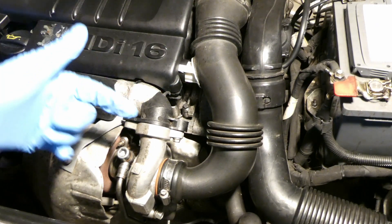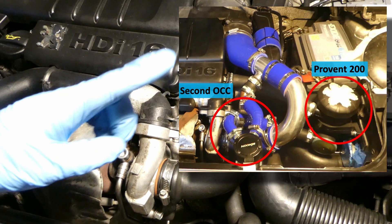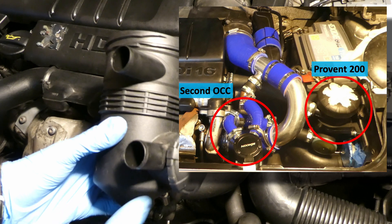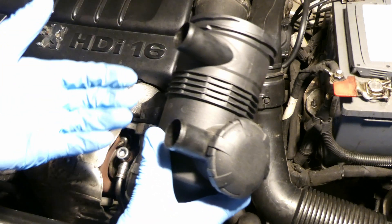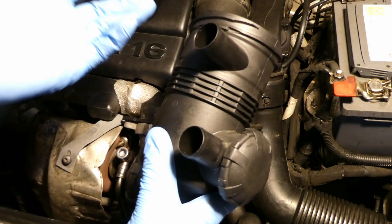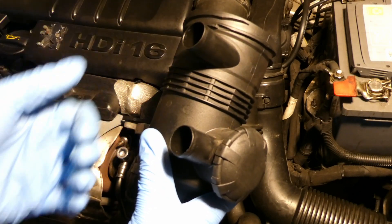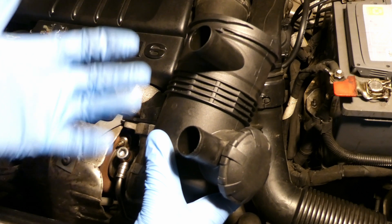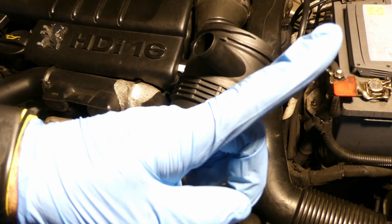The end of the comment was 'no wonder you installed a second oil catch can.' The second oil catch can was actually a test - I wasn't sure how efficient the Proven 200 was, so I hooked up a second one after it to see if it collected anything additional. That had nothing to do with the in/out orientation of the Proven 200. That video tests three different oil catch cans and measures crankcase pressure following installation, comparing whether some catch cans increase crankcase pressure more than others.